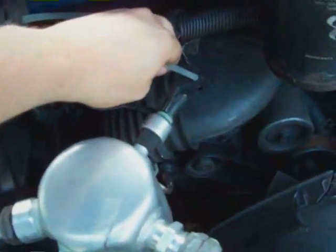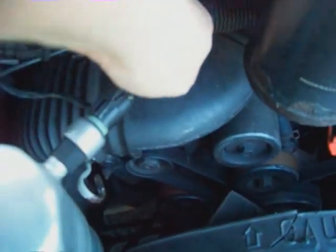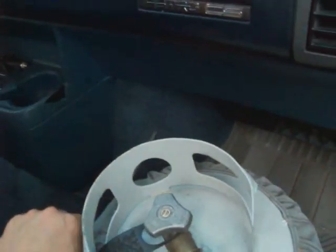After connecting all this stuff, I have taken this tube here which has to go to the air intake. You're not going to see it because I did it in a very clever manner, but up there I drilled a small hole — I've done this experiment before. You run the hose through the doghouse container into the engine compartment, then reach in under the hood and grab the tube, pull as much as you need, and run that tube into a hole I've already drilled into the air intake. This goes immediately before the air filter — normally bottom it out and pull it back halfway — then pull some of that excess into the vehicle.